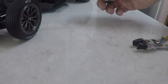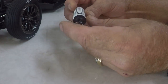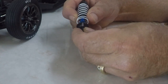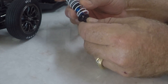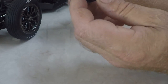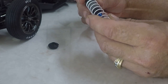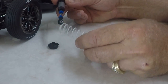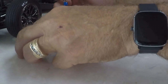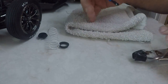Now this is pretty simple. What you do is disassemble the shock — pull the spring up. See how much play there is in there, how easy it comes up? You're risking losing this cup every time you go down the track with the front wheels off the ground. So I'm going to take that off, get rid of that retainer too.